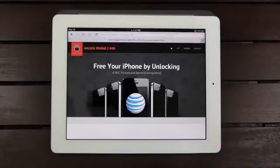If you don't get that message, then all you have to do is restore your iPhone with a SIM card inside of it. If it still doesn't display that message, then just disconnect your phone from your computer, insert a SIM card from the iPhone's original carrier, and connect it back to iTunes. Once it's activated on the original carrier, then insert your SIM card of choice and connect it back to iTunes, and you should be completely unlocked, and again, it's permanent.